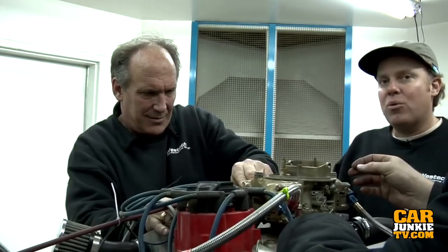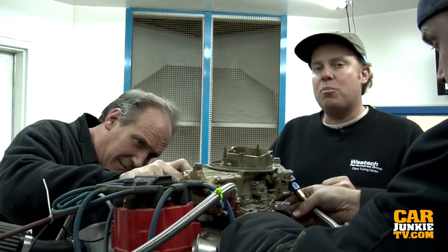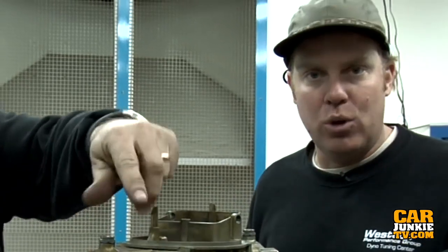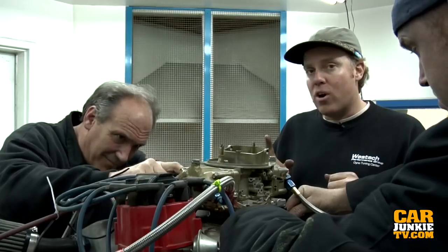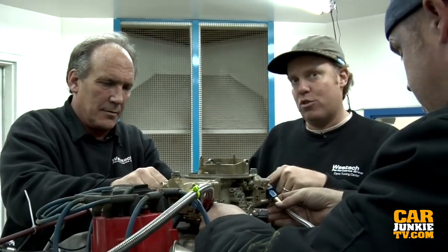What's going on is as soon as we changed to the regular Performer RPM, the carburetor was having difficulty metering right at 2,500 RPM at wide-open throttle when we start the dyno test, and we can't exactly figure out why. It's not intuitive because it didn't do it with the RPM Air Gap. We're conflicted about whether the problem is that airspeed is so high it's pulling too much fuel and going fat and misfiring, or if the airspeed is so slow that the fuel is just dripping and not atomizing.